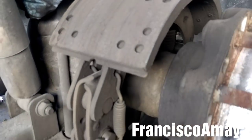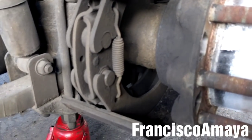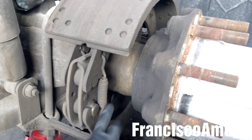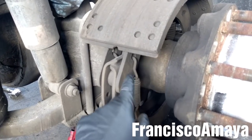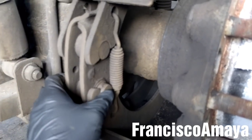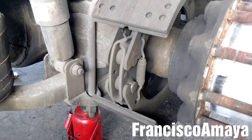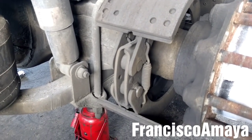These brakes are the 4707. They are very similar to 4709 brakes and 4726 brakes, which have the same type of springs. The process to remove those brakes is going to be very similar to 4707s. You can see the type of spring — it has two mounting supports on the back, which are kind of bushings that hold the rear area of the brakes. The 4709s only have one big one that holds both brakes at the same time.